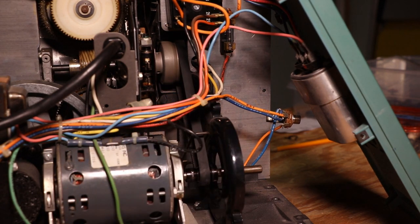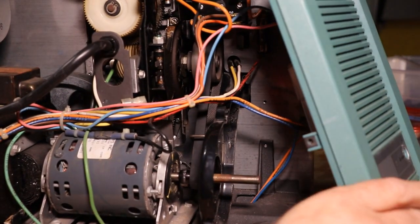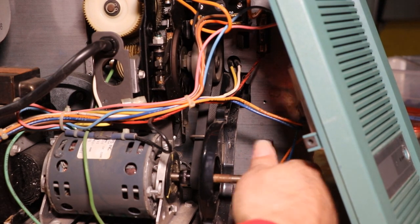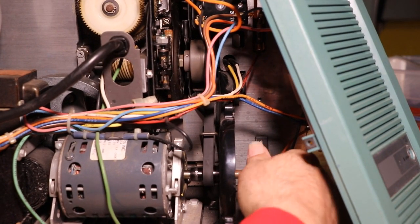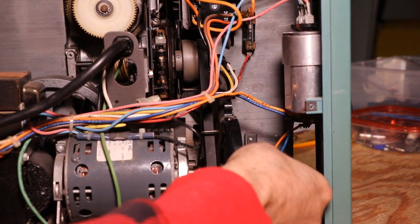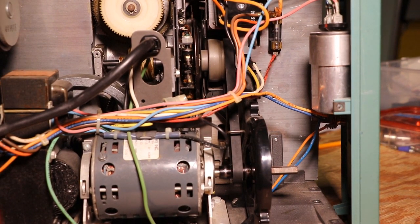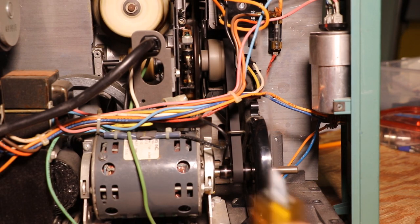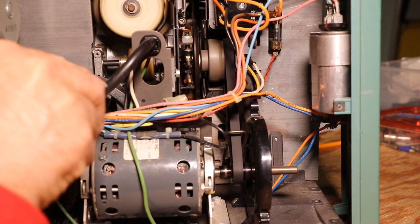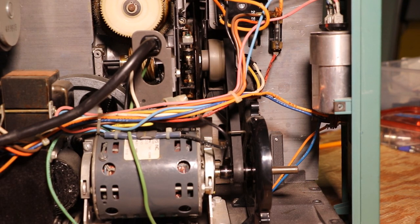It's on the top shutter pulley and it's on the motor pulley. The next step is just double-checking your work so this machine won't burn up. You can see it's turning very nicely now. I'm going to plug it in to check — you wouldn't want to run it very long because the bulb would burn, but for a moment or two we can check our work. Going to forward — and there you go. That belt looks perfect now. All the bad noise you hear in here is that worm gear.